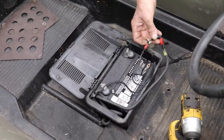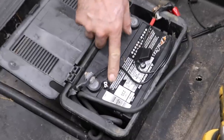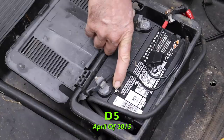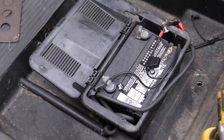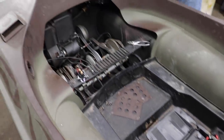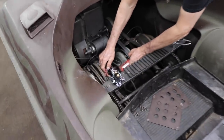I went ahead and disconnected the battery. Look — it's got the code date on there: D5. So this battery is from 2015, it's like six years old and it's still good, still cranking it over. The guy I got it from was right — he did say he drove it like five years ago. Alright, let's get this solenoid on.